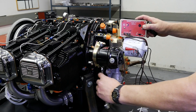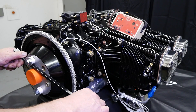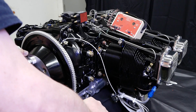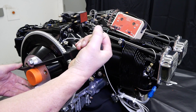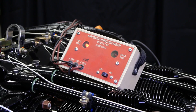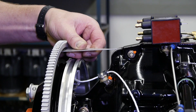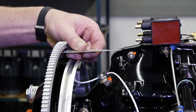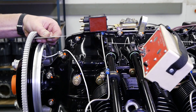At this point you can lightly tighten the hold down clamps so that the mag will not move on its own. Now on the front of the engine, move the crank flange counterclockwise just until the timing light goes out, and then slowly advance it clockwise again until the light comes back on. Double check the timing mark to reference the crankcase split line again. If you are satisfied with the timing, the magneto can be properly torqued — a very important step.